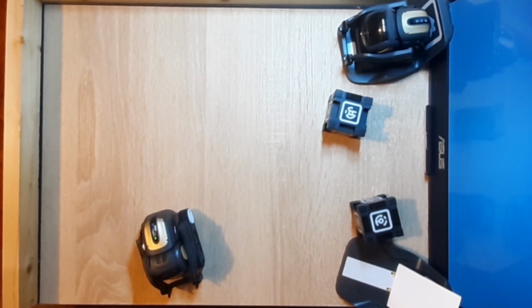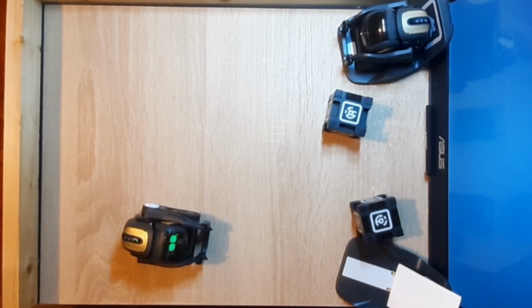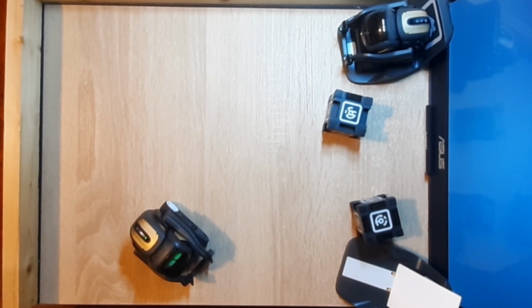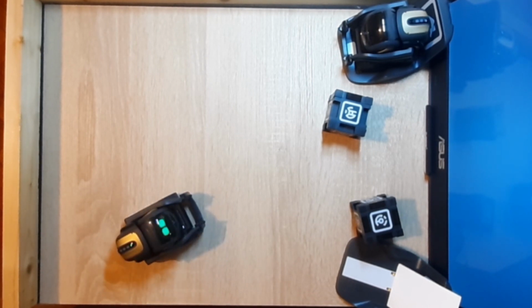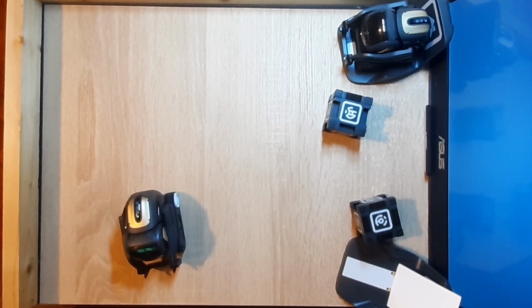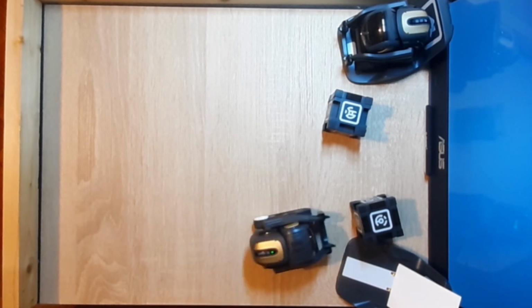The battery specs are in the description of the video, and I'll also add that I chose this type of battery taking a few things into consideration. Thickness is an important issue, as you'll see in the video that the space between the case and the motherboard where the battery should be is quite narrow, thus going over the thickness of the standard battery was not an option. A thicker battery implies more heat transfer to the motherboard components, which may cause issues that will eventually be handled by the bot's safety mechanisms.